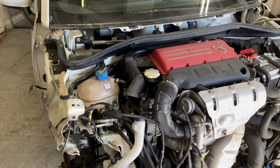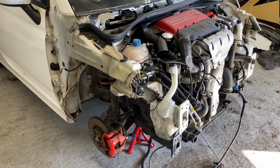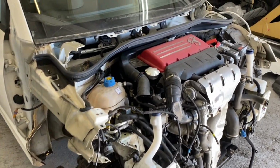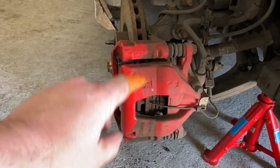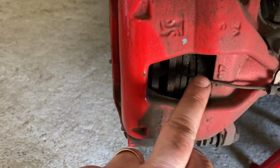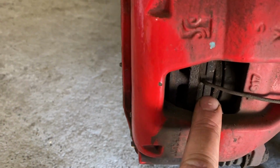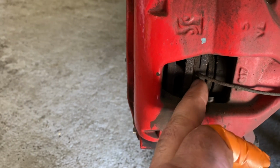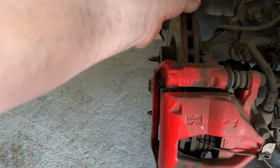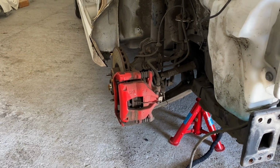So there we go. This is obviously the most, where the damage is. So, there we go. Pads are going to need changing, probably pads and discs on this one. As you can see, that wear indicator is so small, you could just see it. So that's the size of the pad in there. So looks like discs and pads on the front. Discs are right on the back. I haven't checked the pads on the back yet, but definitely discs and pads on the front.